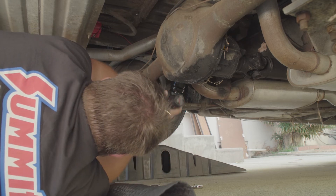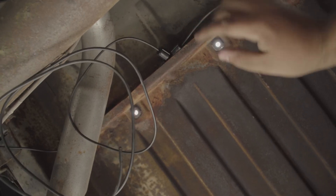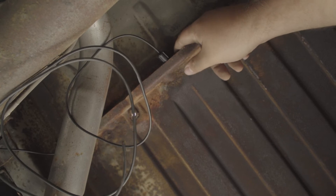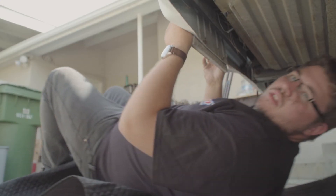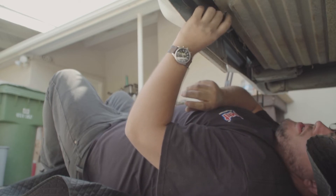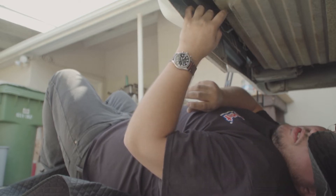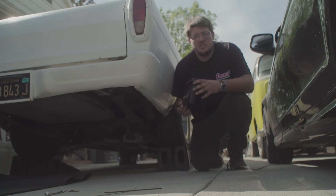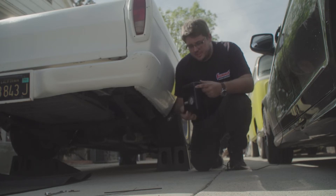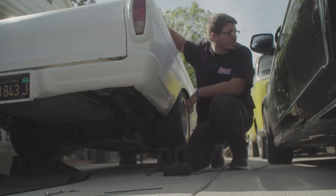Both shocks are in — time to run some airlines, and then I think we can drive it. See if it airs up. I'm going to run this wire to wherever our Schrader valve is. For right now, I'm going to drill a hole here and zip tie this in so it doesn't go anywhere. Airline is in — it's right here. We're going to get a compressor and bring it back here to see if we can fill this thing up with air. I'm going to use this little compressor from my Mercedes. The instructions say to go to 20-something PSI and then start to look for leaks. If there aren't any, we'll pump it up more. We should see this rise pretty far up.